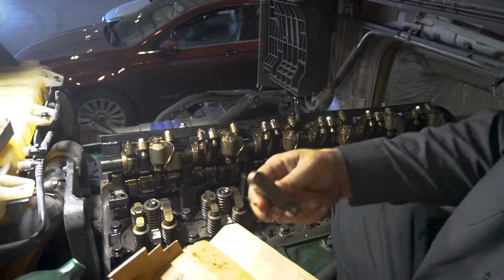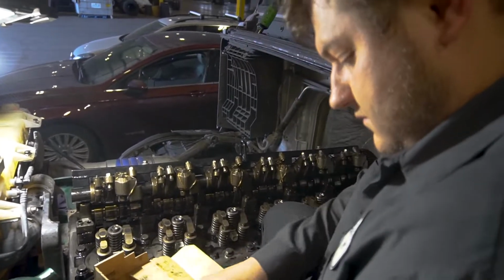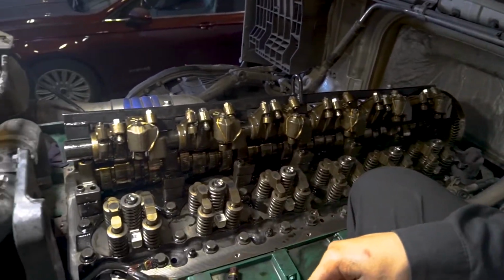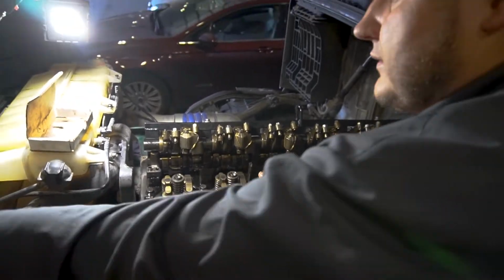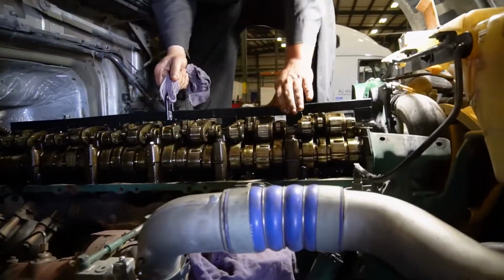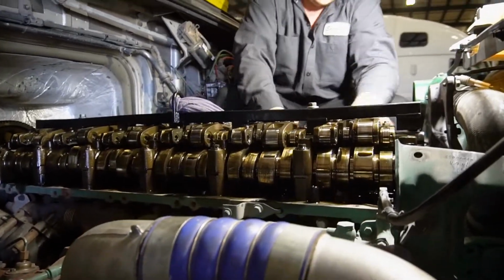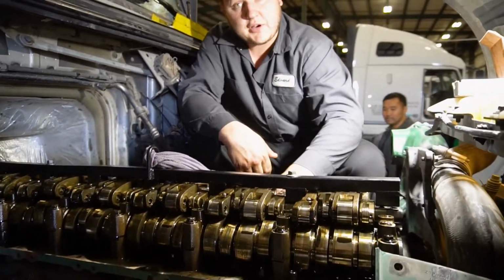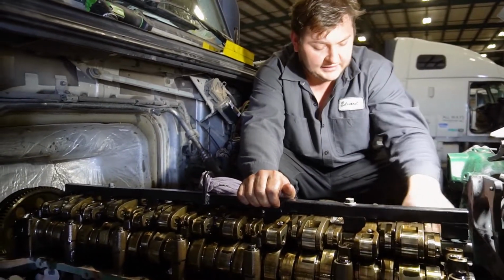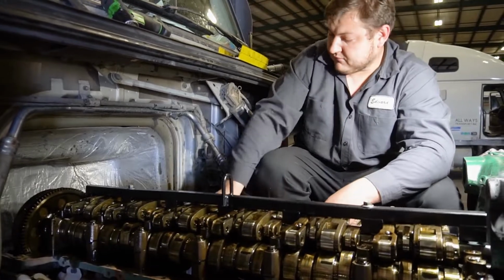And show you all the way how this is done. And that's it. All nice. Okay, grab a rag, push it on here, set that all the way through, and make sure you check all these. The ones that we're putting on, the valve bridges, always check them. Always make sure everything is good, everything nice and tight, nothing slipped off from the exhaust valve, intake valve, none of that. Check it all out.